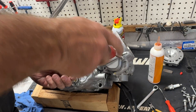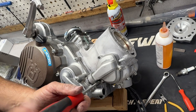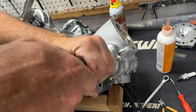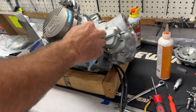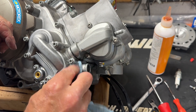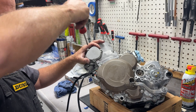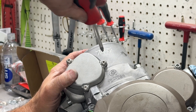Looks really good. On the older bikes these things leaked even worse. You don't have to go crazy tightening these, but get them good and snug. I wouldn't put a ratchet on there and risk over-tightening them. I put a tiny bit of contact cleaner on my paper towel and clean up any ugliness from the silicone. Our other cover with the gasket is sufficient with no sealer — it's usually just fine on this side. I put a tiny bit of grease on the O-ring — be careful not to stretch it out — just enough so it stays in the groove. You really don't need silicone on an O-ring.